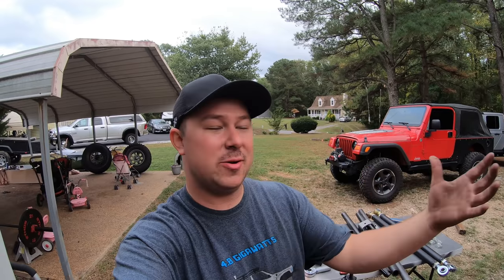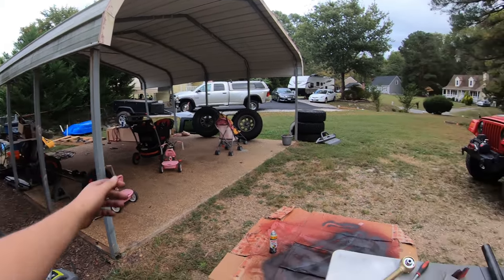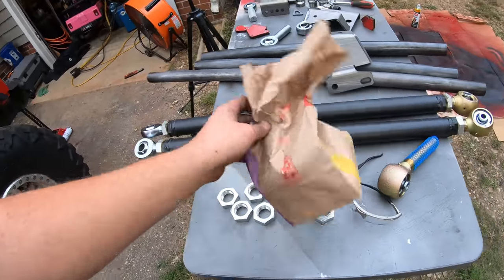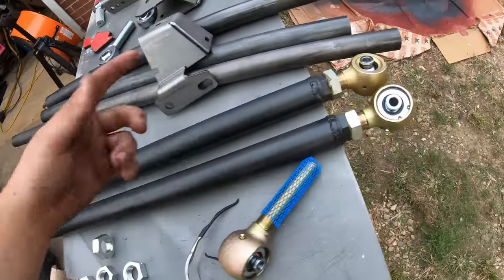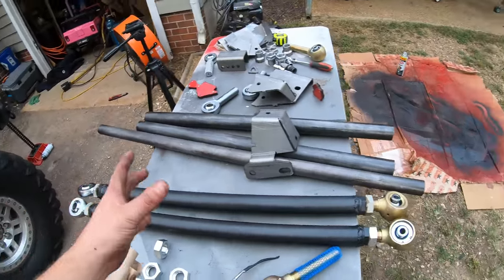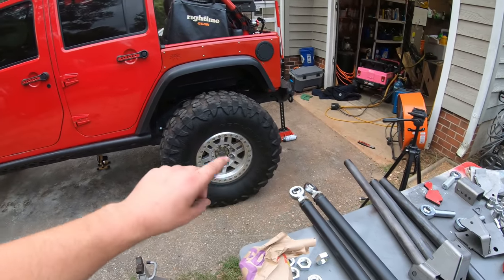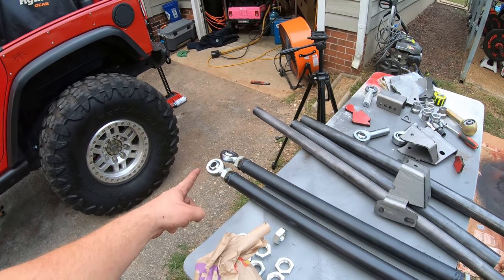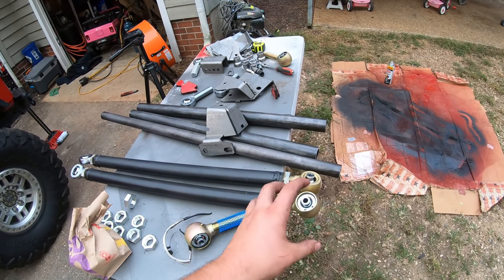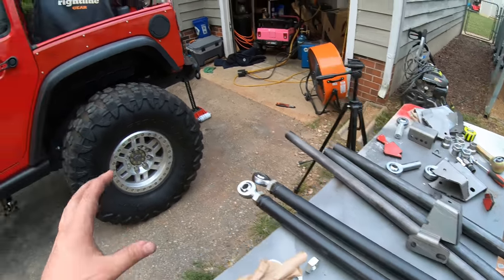I've been at it for about six hours — not bad especially since we're filming. If I was doing this alone with no camera, probably three or four hours. The upper links are looking really good — definitely very heavy-duty heim joints and the offset enduros look great. Why not go with heims or enduros on both sides? The Enduro alleviates vibration from the road, while heims are stiffer but arguably stronger. The best setup is a heim on one side and an enduro on the other — the enduro gives vibration resistance and the heim gives extra misalignment for flexing. For the uppers, we're running heims on both ends for maximum misalignment.